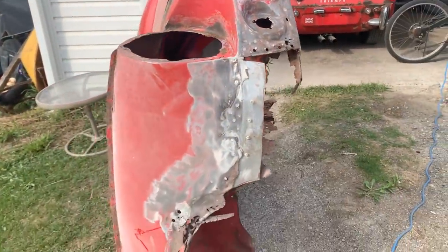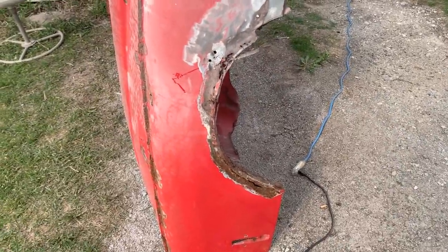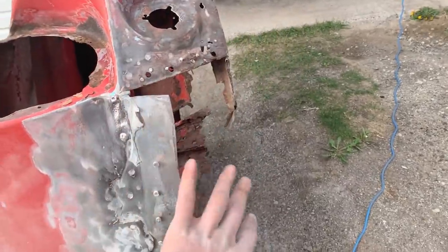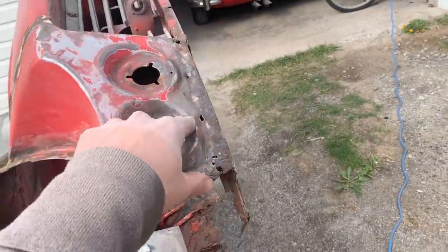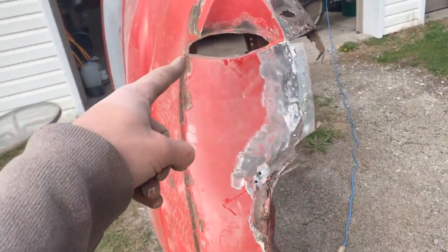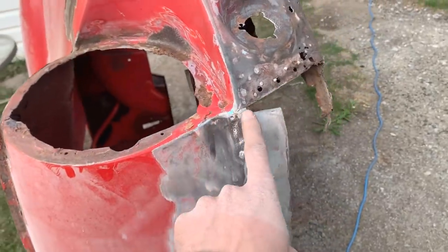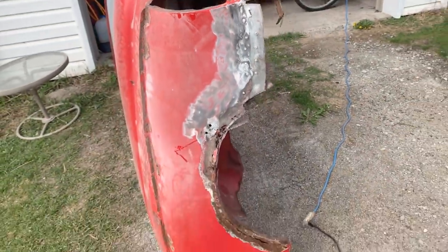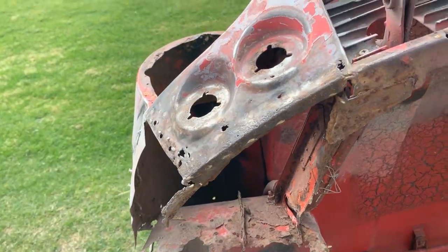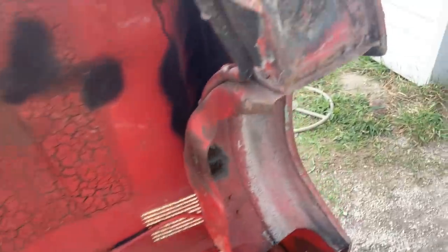I'm not gonna go too much in this area because as we were discussing with David, probably this whole fender needs to be replaced - or at least just the wheel arch. This part is missing, so this is a separate panel. This panel we can repair the little holes here and there, this flange can be repaired, but the fender comes from this flange around here and there's a joint here. I think this whole fender is gonna be replaced.